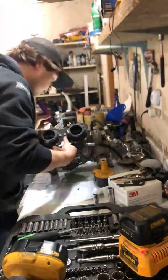All right, this is how far I got it torn down. I got all the bolts on the bottom loose but something's still holding it right here — it's split down there but not right here. I think I probably want the flywheel off anyway when it splits. Here's everything else that came off — the cylinder and all that good stuff. I'll get the flywheel puller and get that pulled off. I got these long bolts that are the same thread that thread right in there, and this is actually the flywheel puller. You put the bolts in there, it goes on right there, and that thing on the end just pulls it off the crankshaft.